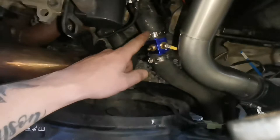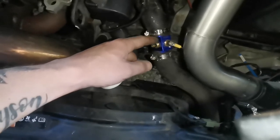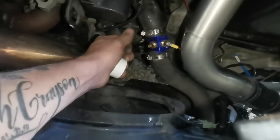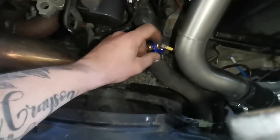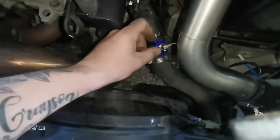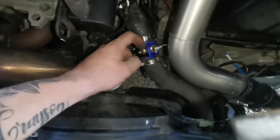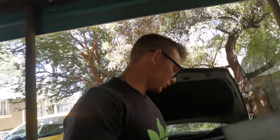I purchased this sensor pipe bracket, or whatever you want to call it, yesterday, and we drilled and tapped the M10 by one thread into the aluminum casing just to make sure that we can get another sensor in there, and it seems to be holding water perfectly fine. We cut out a piece of pipe just a little bit longer than this to make everything seat properly. This is the one for the heat gauge. It is currently, in my eyes, I did something wrong, so it's not picking up the correct temperature signals. But I'm going to address that now. I'm going to use this one for the ECU to get a heat sensor off, just to get a cold start and to make sure that I can run the fan off of the relay. Let me get to work and sort out all the wires and get the car to the point where I can start using it on a daily basis.